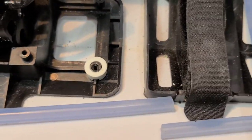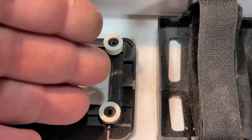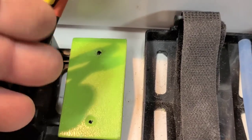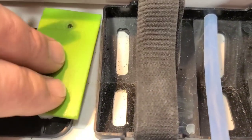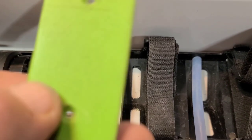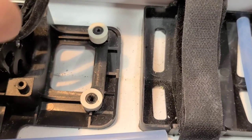Basically what I'm doing is enlarging this post so it gives us a little bit more surface to mount our ESC onto. If we were just to screw this ESC tray onto the post without these spacers, it may want to teeter totter, I guess. So I think that these spacers will help give the ESC mount a little more rigidity. That way we don't have to cut our boat, okay? Leave it stock in case we want to put the stock ESC back into it.